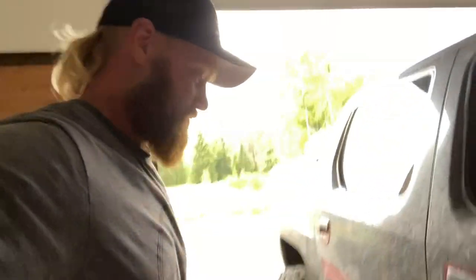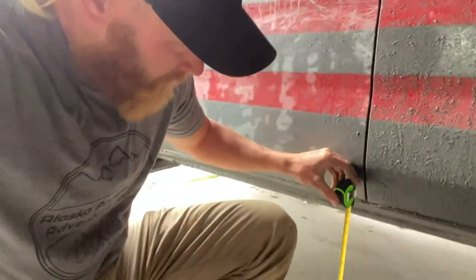And they're performing great. I don't have any shuddering, and the axles aren't binding when I'm at a turn and I hit a bump. They were, but I had it up an inch. So I dropped it and we're good to go. Have you ever seen a Ridgeline with almost 6 inches of lift? I don't think so, until Renegade. We're blazing trails here.